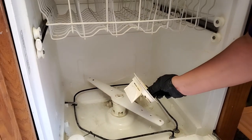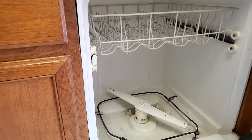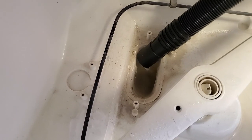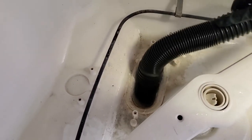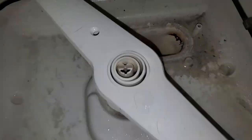There's one additional piece down in there. And because the water has been standing for so long, I'm going to go ahead and soak these pieces in some bleach water. All right guys, we've shop vac'd all the water out of the dishwasher. Turns out there was a little bit of debris there and we removed that as well. Now I'm going to run a cycle using a little bit of CLR. This is going to help ensure that the lines are clean and clear, as well as remove any lime or calcium deposits left from the standing water.